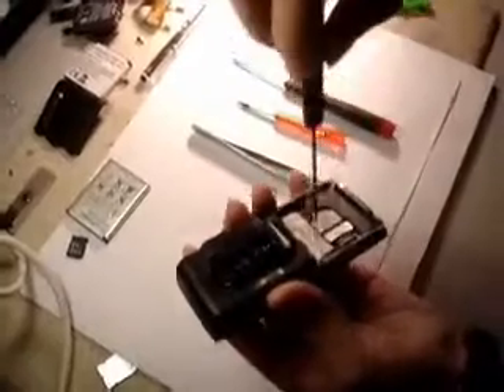Make sure the camera lenses are closed. There are two clips on each side of the back housing — you can use your nail, a plastic separator, or a guitar pick. Once you unclick those four clips, push it upwards towards the top and the back housing should come off pretty easily.